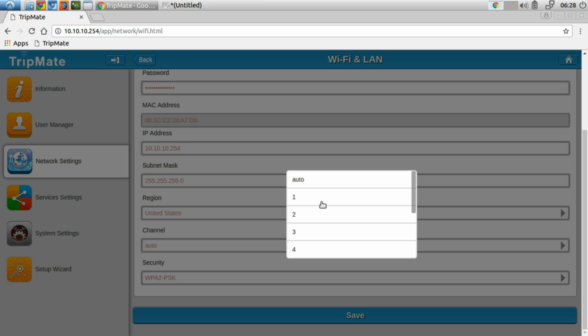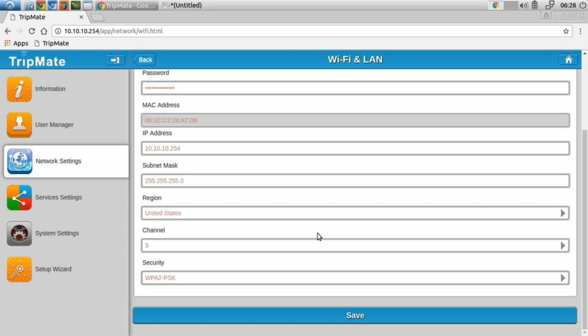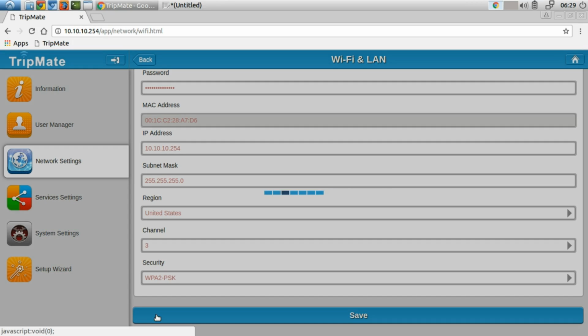So what I'm going to do here is put it to channel 3. And as I mentioned, auto's fine. You don't have to change it to channel 3, but like I mentioned, these are my custom settings, how I typically put my channels on channel 3 and channel 9 to kind of avoid that overlap. Almost essentially put it between the two, use the 2 empty spaces, ish, of the 3 major channels of 1, 6, and 11, just to avoid any additional interference.